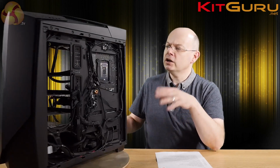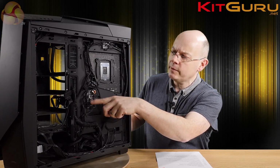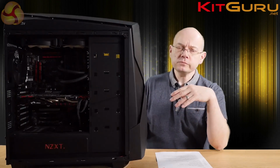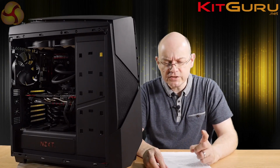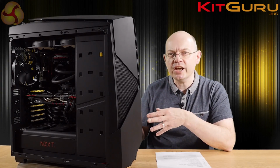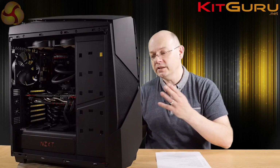Having said that, this case, the Noctis, comes with a little PWM hub for all the fan connections, and the Kraken's hooked into that. So actually, it's only this one connection up here on the top of the motherboard, the CPU connector, that controls everything. So the CAM software is not necessary. In other words, it's not controlling the liquid cooler. I installed it, it didn't actually change anything. It's there, it's good software, why not? But they didn't. There we go.